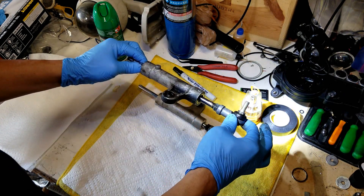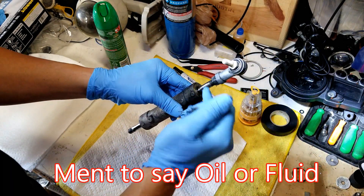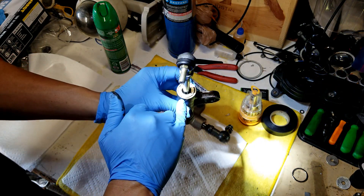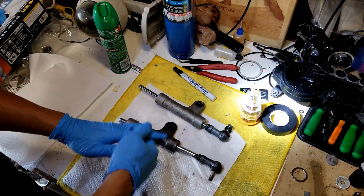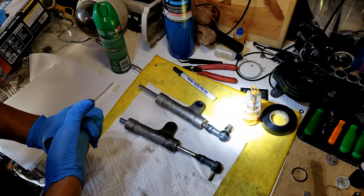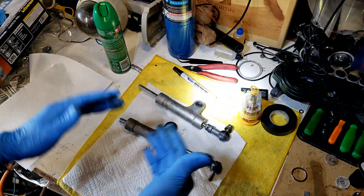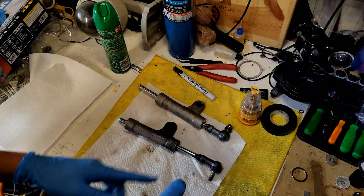If inspecting yours you happen to see any grease or fluid coming out, technically you should be lubing this area for nice smooth action. The book says to use Suzuki grease - possibly white lithium would work. You can see all kinds of grease buildup on the old unit, which confirms this was my issue. Installation is just doing things in reverse order. That's going to be it for this video - go ahead and like, subscribe, and don't forget to share. Leave something in the comments below if you need any assistance with this or want to know where to purchase. As always, I'm the Chemist, and I will see you next problem.